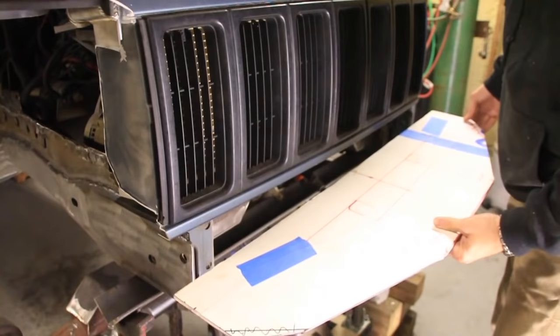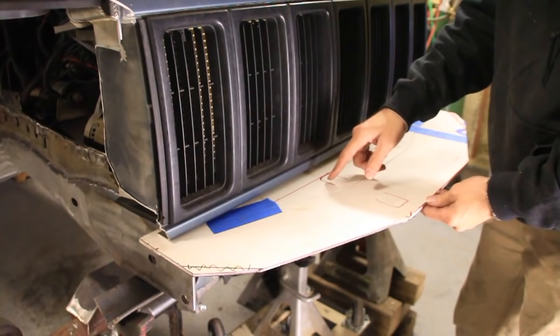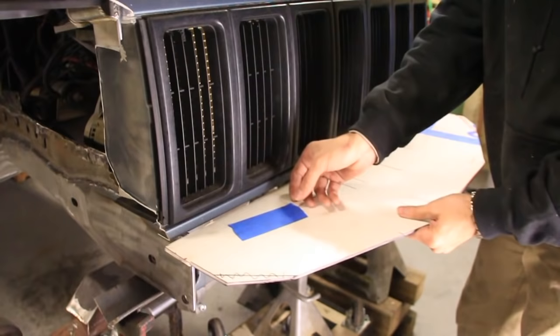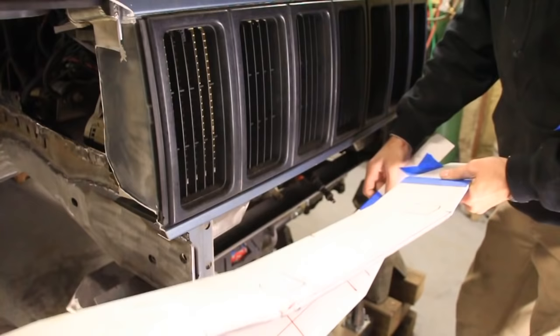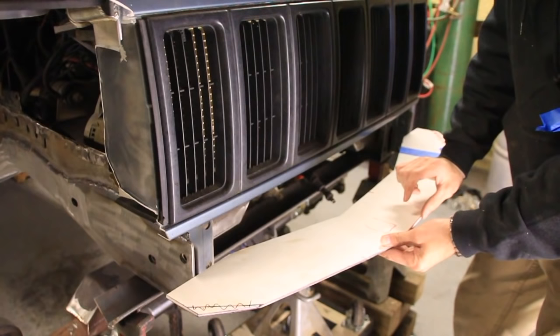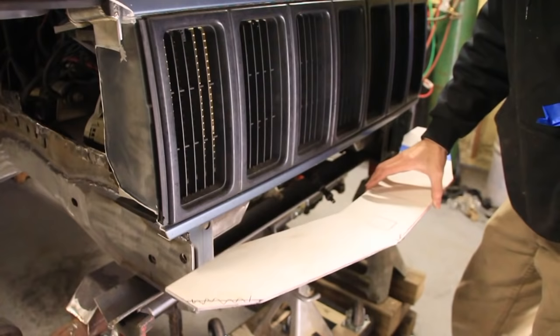So I'm going to keep the bumper as short as possible, just enough to get a winch on here, and get it as high as possible to keep it out of the dirt and rocks. So let me show you what I've done. The first step is to make a template — I like to use this foam core board. This is going to be the top plate of the bumper. Once I got that done, I made sure everything was going to fit. Right here you can see where the winch is going to mount, just barely covering the edges of the winch so rocks hit the bumper first. I also needed a bottom, but the bottom didn't need to be as big. So I'm going to have a top piece here, about an inch and three quarters, and then the bottom plate. It's not going to be very thick, but that's the whole point.